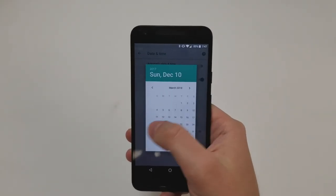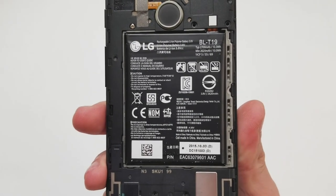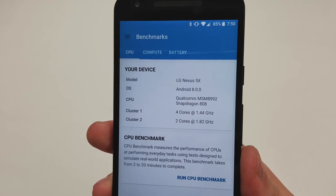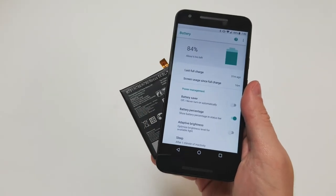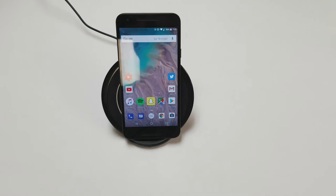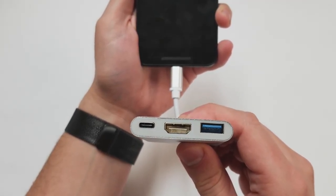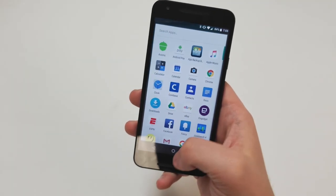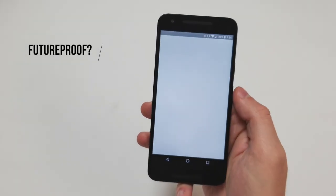The last score is future proofing. The major issues with this phone are the boot loop problem, battery issue, and lack of external storage. The boot loop is generally caused by the processor or the battery — the Snapdragon 808 is known for overheating and these processors do fail. I've already sent this phone to LG to fix the processor. The battery drains quickly but isn't too difficult to replace. Wireless charging, external storage, and optical image stabilization are all missing. OTG is supported through the USB-C port. The phone does have a USB-C charger so it is ready for the future, but it's already on Android Oreo and most likely will not see Android P. The Snapdragon 808 can somewhat handle Oreo but there are times it struggles. The future proofing score is 5.5 out of 10.